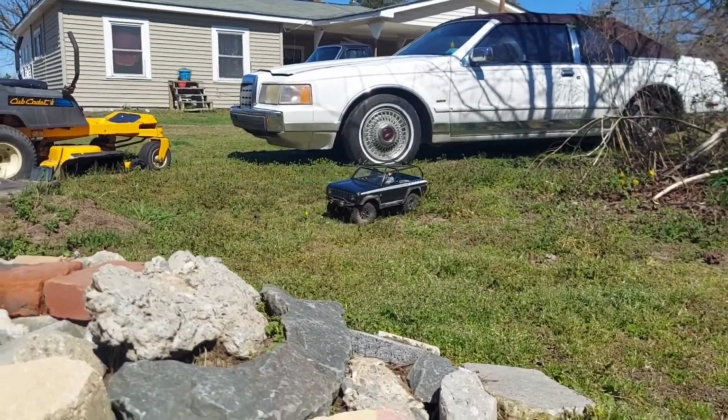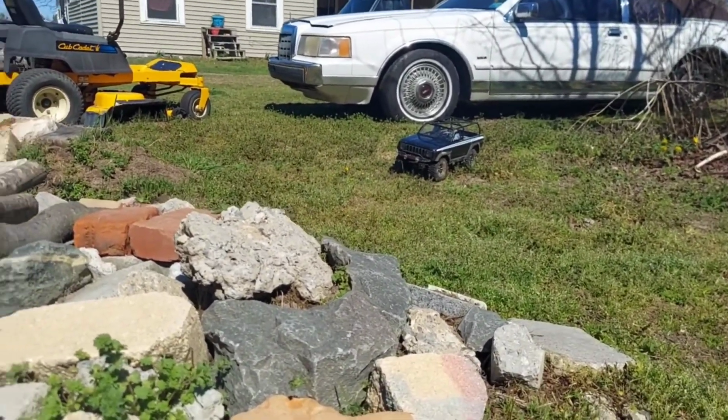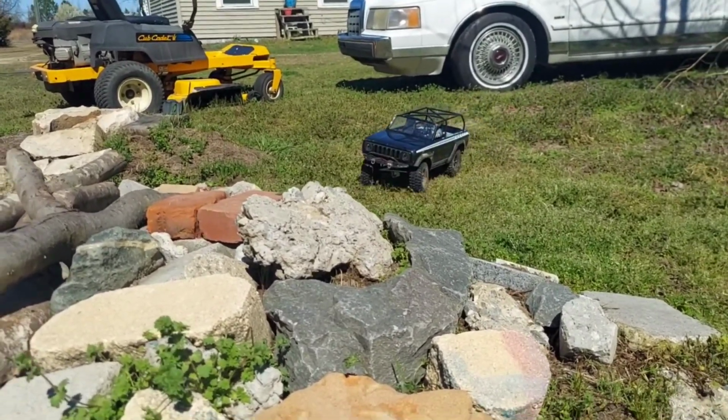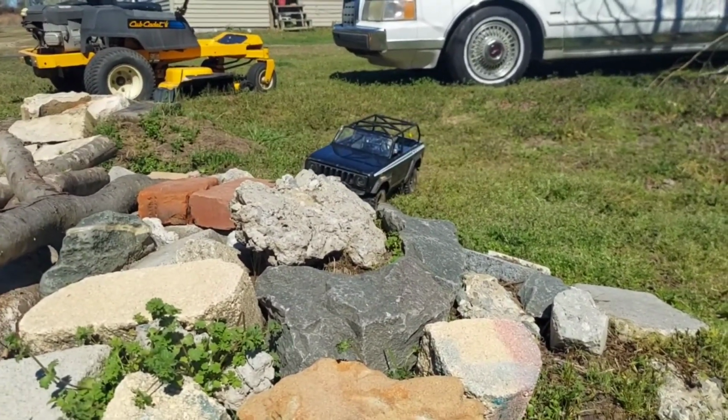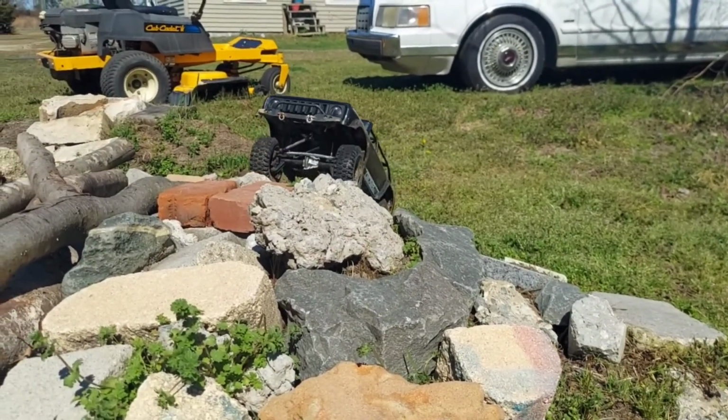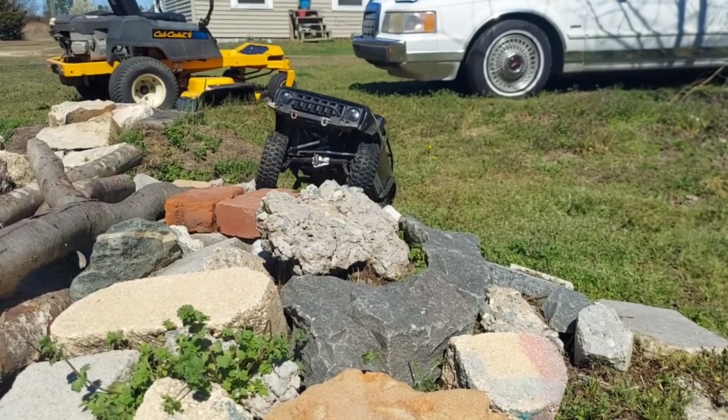I'm gonna probably put that 17 tooth pinion back on it and get the speed back. Now that I got this motor with the torque, I don't think it'll matter about losing torque. I don't think this motor would lose any torque with that pinion, really. Not much. And get my speed and slow crawl in.